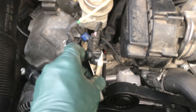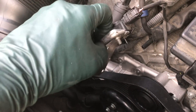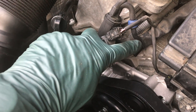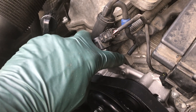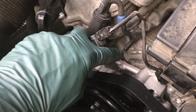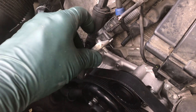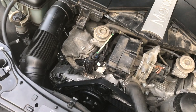I absolutely know this is going to solve the problem, and once I clear the codes I can just forget about it. I've cut the rotten hose off the end of this little nipple and shortened the new hose to about an inch coming out of this cover. You don't have a lot of room to work and you won't be able to have a very long hose here or it will kink. Now I've got to plug that in before I put the bracket back in place.